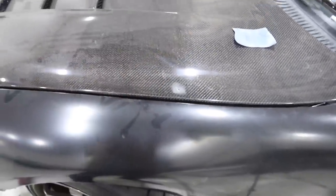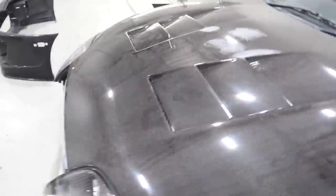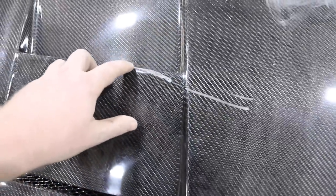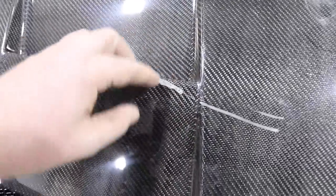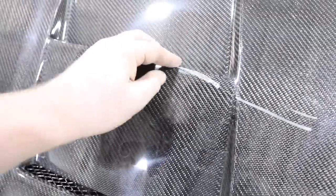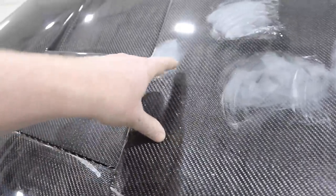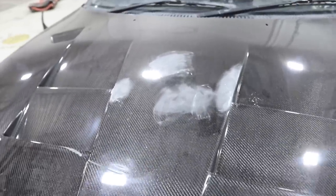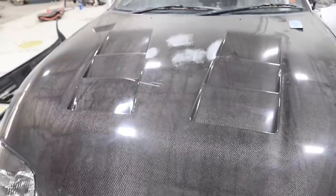It's kind of up to you whether or not it's worth it, because if you had to have a body shop spray it with clear, trust me, it ain't worth it — it'll cost too much money. So we're going to be fixing not only that, but just by sanding it and having body filler. This is our own damage that happened in storage. It's a gouge with a hole that's falling off the wall here — use a piece of tape, build it up to roughly the right shape, and that'll help hold your body filler in there while you're back-filling it. These were other low spots that we saw in the clear gel coat, so we identified them by sanding around them, and we'll put a little bit of glazing putty over that to take out the wobblies.